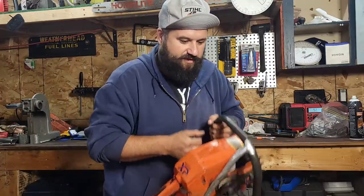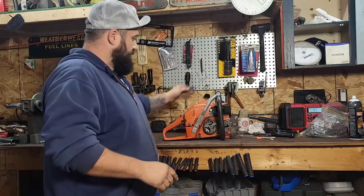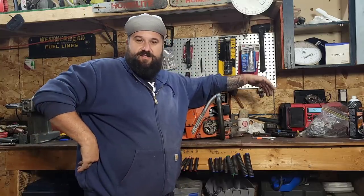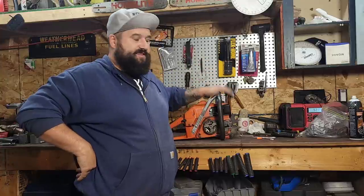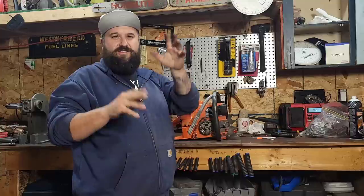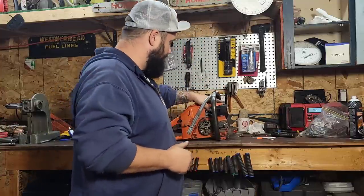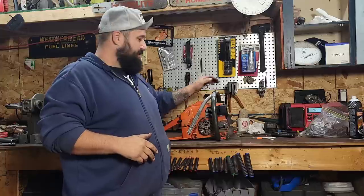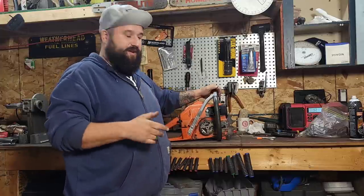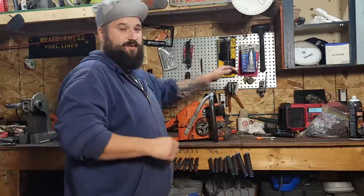Before I take them into the woods. So right there, you guys will see us turning them upside down just to check for air leaks. When a saw is new, in the first firing video, sometimes they'll change their tune. Remember, friends, it takes a while to burn the oil out of the motor. This one took quite a bit, and it's still a little bit smoky. There's still some residual oil inside the motor from assembly.